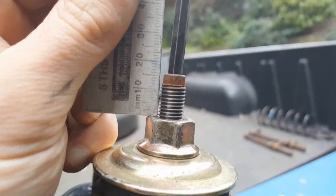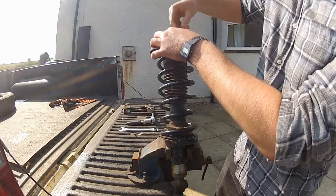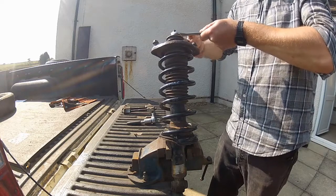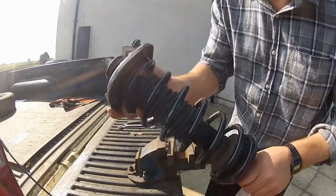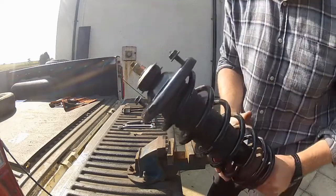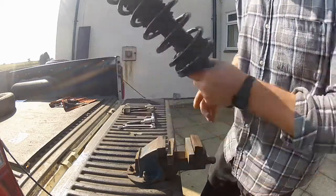There's 16mm of this threaded section left above the nut now, so that's done. All that's left to do is reinstall this lock nut. That's one strut ready to go back in the car. I know what you're thinking - why have you gone and put that top mount on there when you need it? For you guys, to show you how. When I turn this camera off, I'm going to remove this again and get it stuck on top of the TN coilovers, which will then go back in the car. And that is how to replace your coil spring on a coilover setup, the safe way. Thanks for watching - if you like the video, don't forget to give it a thumbs up, and subscribe to the channel if you want to stay up to date, because I do try and get videos out every month.